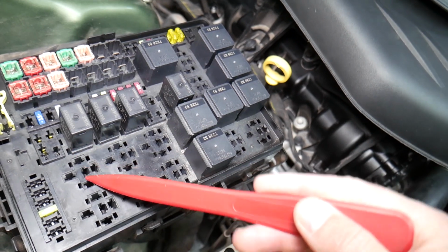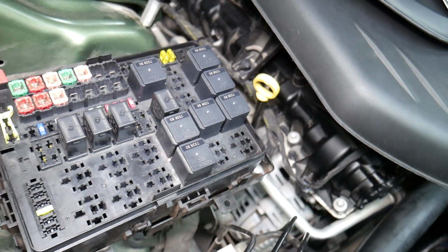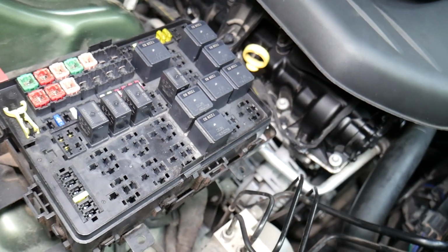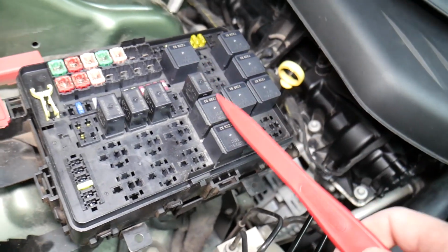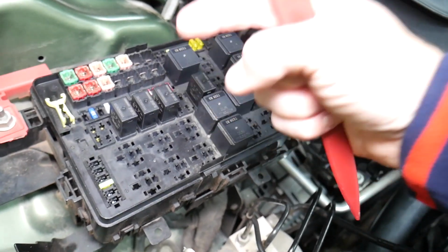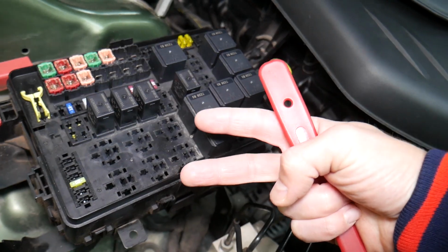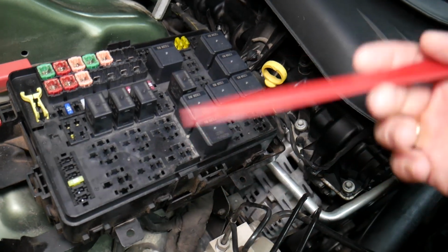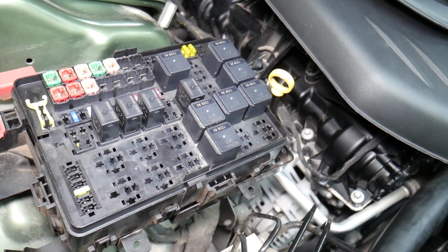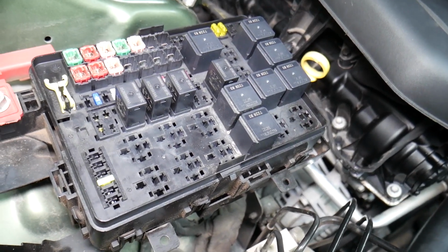And for some certain fuses, it's important to disconnect the car battery when removing them, otherwise you can burn the electronics. And for instance, working on airbag fuses or anything like that, you need to wait at least 1 hour after disconnecting the car battery, and if you're not qualified and certified to work on airbag system, I will never recommend to do that. But when disconnecting the car battery, common mistake people make, it's important to know which battery terminal you reconnect first. If you do it the wrong way, you can burn electronics modules. How we know about that? We burned before the traction control module on a BMW that cost us $2,000. So we'll put a link in the description of the video below which battery terminal to disconnect first. Check it out for your convenience.